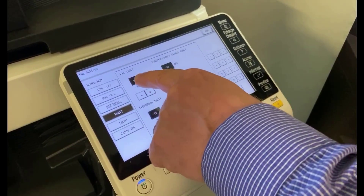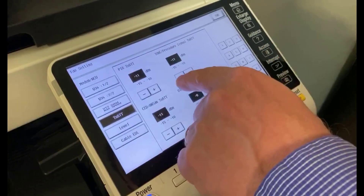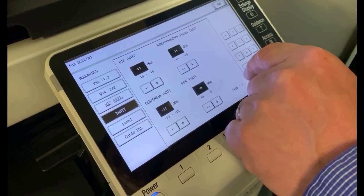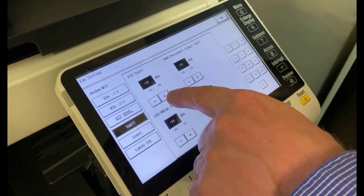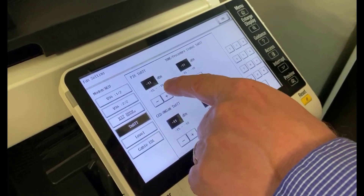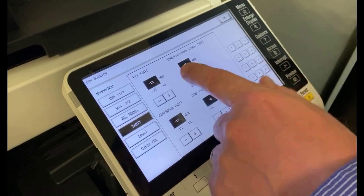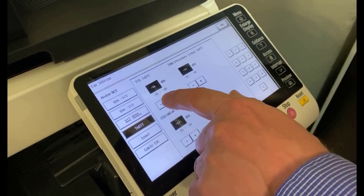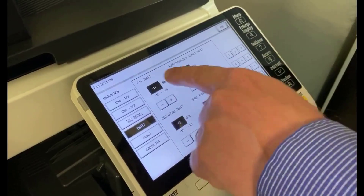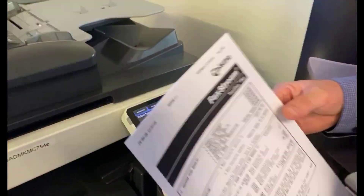What we want to adjust is the one at the top left here — the PIX TXATT setting. By default that's at minus 11, and I think that's the same for all Konica Minolta models. When the transmission level is too low, you may have to increase that from minus 11 to maybe minus 12, minus 13, or minus 14. You can do a bit of trial and error and check the report. Once you've adjusted that, click end and exit, then perform another fax transmission report and you should be able to go from poor to excellent.